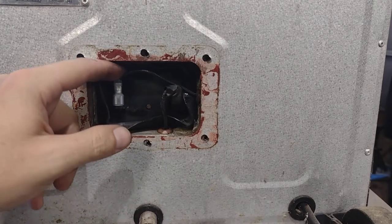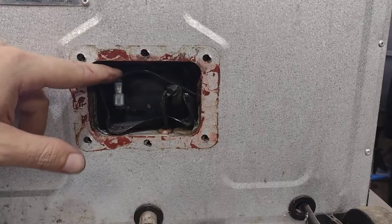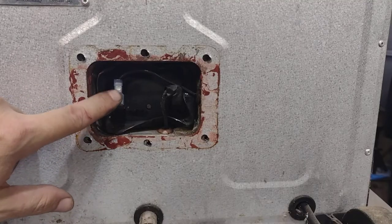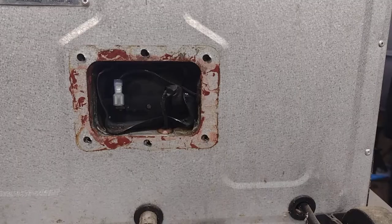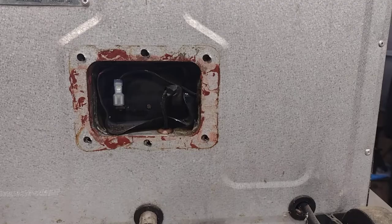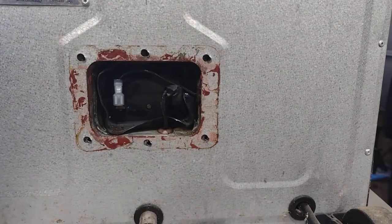I got the old bit of wire clipped off and the old terminal removed. I have these insulated female spade terminals laying around — I put one on there. I'm not sure if it's going to hold up to the heat back here, but I just wanted to hook it up to see if this thing is going to work. If it works, I'll go get the correct terminal for a more permanent fix. For now, I'm going to put this plate back on, plug it up, and turn the power on to see if it starts building up heat.